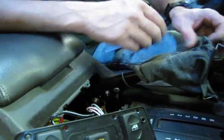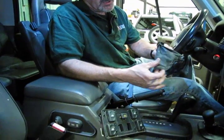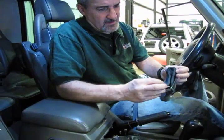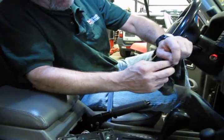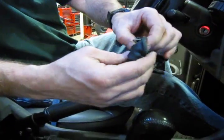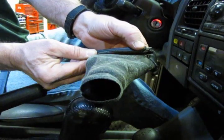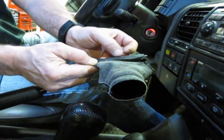Leave the O-ring right on the handle — that will allow you just to peel the boot off. Before you take it off the bracket, look at the orientation: any seams, any openings, any grooves. Anything like that gives you a hint that you want to put it back on in the same direction. Slide the boot off and it will just slide down. At the bottom there's a flap, and this flap is going to fold over the middle bracket just the way it is. The same on the sides where it's folded over — that's how you're going to reattach the new one. Run a bead of super glue along the new one, fold the flap over, and you may want to take a measurement of the width of this flap against the new one and put a chalk line on there as a fold guide.